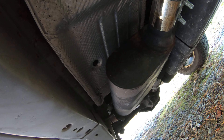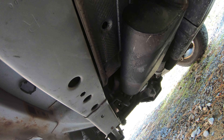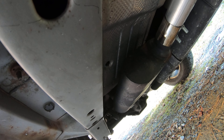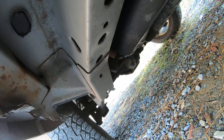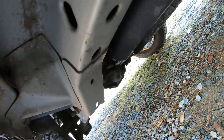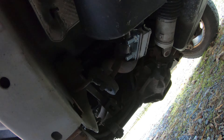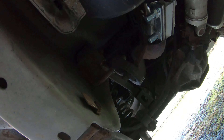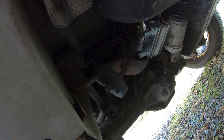The muffler itself has gotten a little heated up. Like I said, it smelled for about a week or two just getting broken in. We got it all pushed back in and still have one of the original hangers right here. I had to cut off a good bit of the tailpipe that's in there to get it to work right.